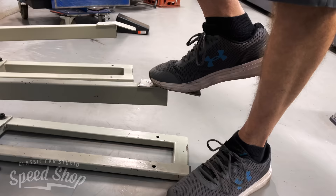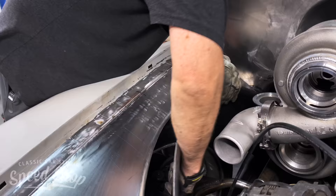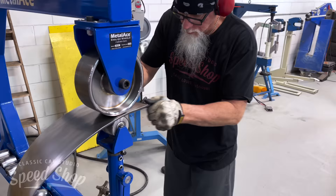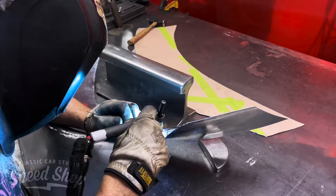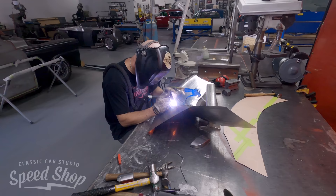Once we're on to metal, there's a lot of stretching and shrinking — getting all the big tools out, a lot of hammering and dolly work, and a lot of test fitting. Once it's all test fitted, we trim it down, butt weld everything with the TIG welder, metal finish it up, and put it in for a few more test fits. When it's all said and done it'll fit like a glove, popping right in and out.